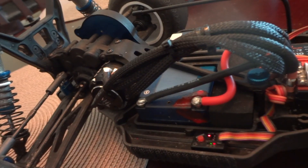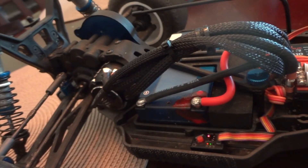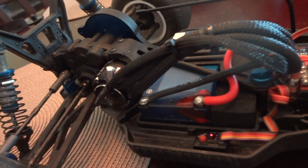Press your throttle all the way and hold it and press the button again. Now you hear a beep. Press your brake all the way and hold it and press the button one more time. Now take your hand off and let it go to neutral.